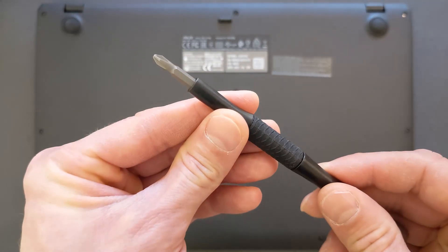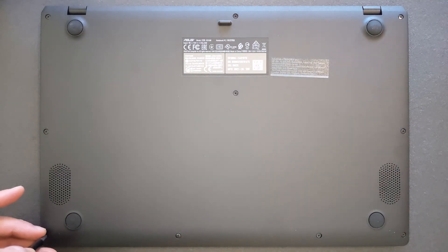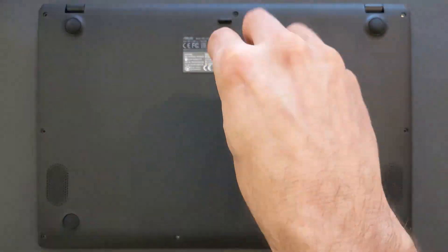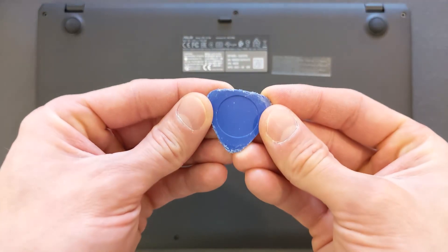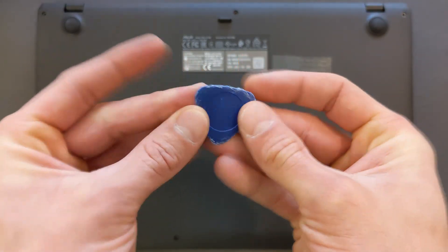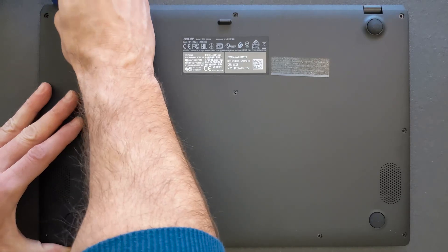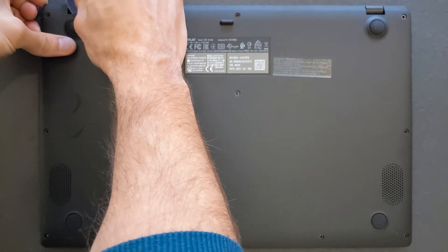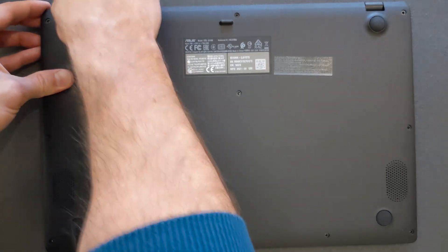You can see how to open up this laptop as well. You need a little Phillips screwdriver and you have to remove all the screws on the back panel. There are no hidden screws - all the screws you can see. One thing I have to say: some screws are different sizes, so keep them separate and remember where they came out so you can put them back exactly. You need something plastic - don't use anything metal because you can damage your laptop, or worse, damage your fingers. It's gonna take a few minutes to remove the back panel. It does resist a little bit - this laptop is brand new, it was never opened.